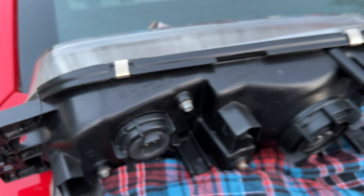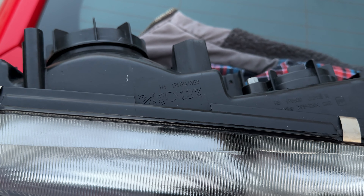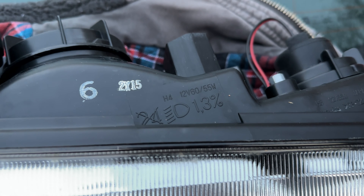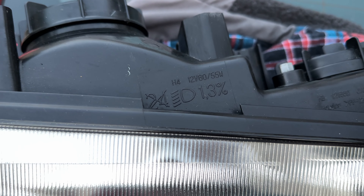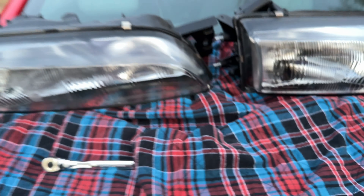Let's turn them around to look at the top markings. The UK edition shows the wattage for the bright headlight and the regular housing. The new one shows the same: H3 12V 55W for one position, and H4 12V 60/55W for the other — pretty much identical wattage-wise. Other than this one being made for the left-hand drive market and that one for right-hand drive, and the fact that the new one comes with the headlight leveling motor, I really don't see what the difference is.